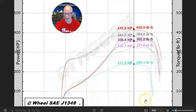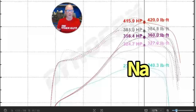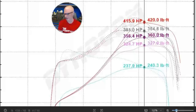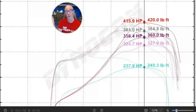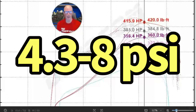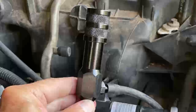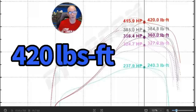This thing made 237–238 horsepower naturally aspirated. We stepped up successively in different boost levels. We started out with just the spring on our wastegate — the wastegate comes with dual springs, we took one out — and ran it with a single spring at the lowest boost level we could. That produced a little over 4 pounds, 4 and a quarter pounds, 325 horsepower and 328 foot-pounds. Then we stepped up using our manual boost controller up to a peak of about 8 pounds, where it made 416 horsepower and 420 foot-pounds of torque.